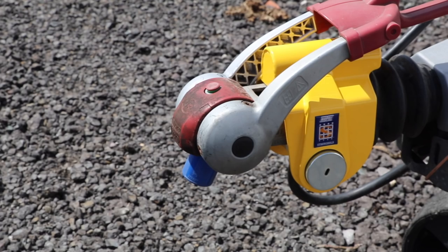A common question I'm asked is: are you allowed to keep the hitch lock on whilst towing? Technically speaking, there is no law against keeping a hitch lock on whilst connected to the car and towing. However, the emergency services take a very dim view to a hitch lock being connected to a towing vehicle. If your caravan needs to be taken off for any reason in an emergency, that hitch lock will hinder the process. So if you're in motion, don't have the hitch lock on. If you're parked up at services, by all means reconnect it.